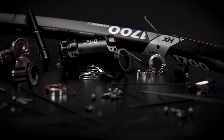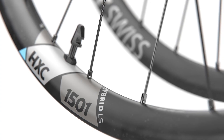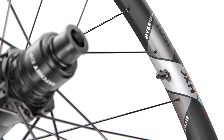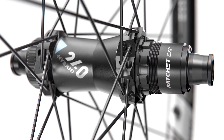You still want a fast wheelset that is durable enough for the e-bike field. The HXC 1501 Light Support is our top-level wheelset in the light support segment. It is a combination of a lighter carbon rim than we used in the normal hybrid wheels, combined with a 240 Spline Ratchet EXP oversized hub with 30-tooth ratchets, together with a triple butted specifically developed hybrid spoke with a 2.15 mm spoke head.